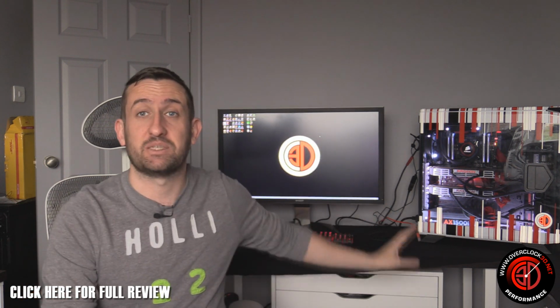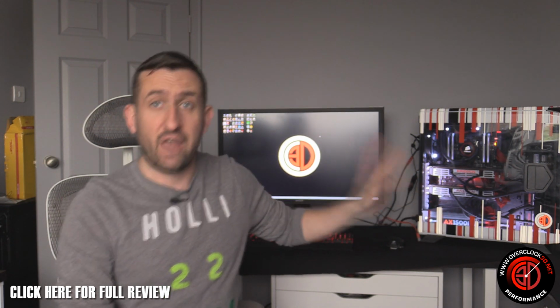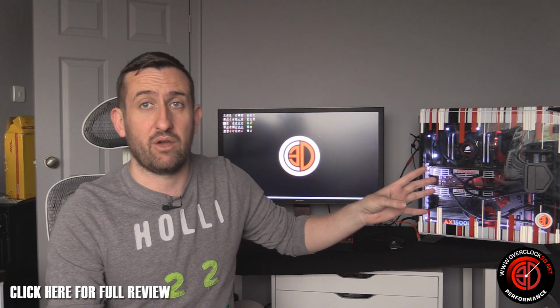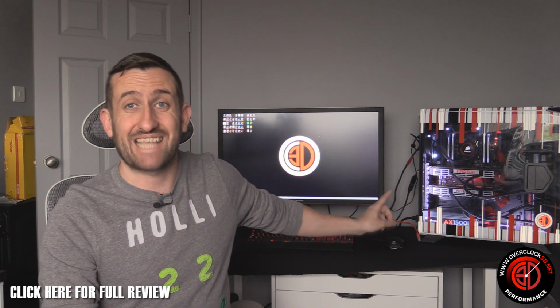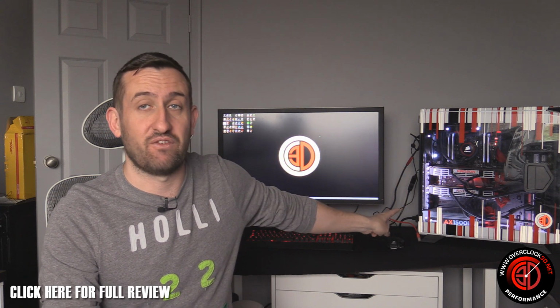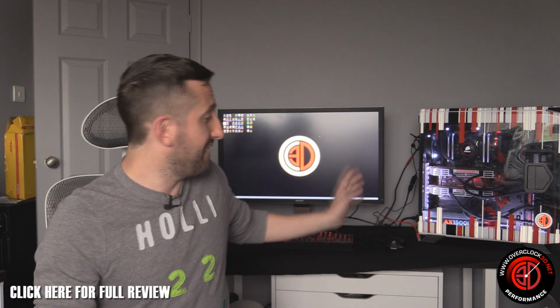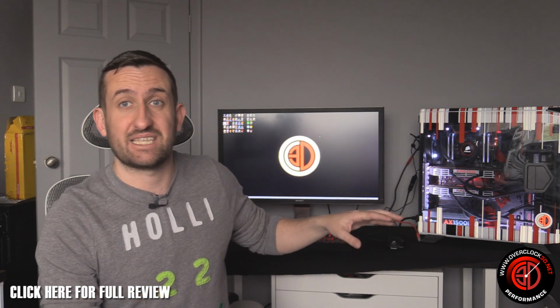So really, with something like this, please remember, I know there's £2,000's worth of graphics cards in there. I know it's bonkers. I know you're going to need a power supply which is the best a manufacturer can provide, because that quite literally is the best power supply Corsair has ever made. And if I hadn't got that in for review, I couldn't have done this review with these two graphics cards, because the AX 1200 watt couldn't have coped with it. I would have ended up having a second power supply in there, probably an AX 860 or something running the system, and then the AX 1200 watt just to run the graphics cards.